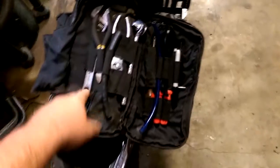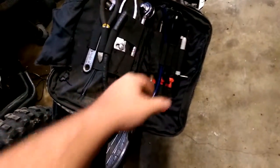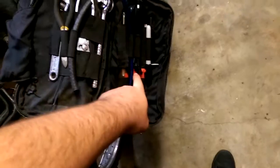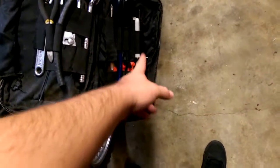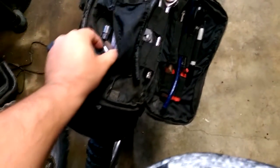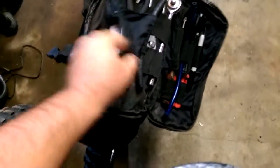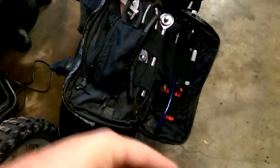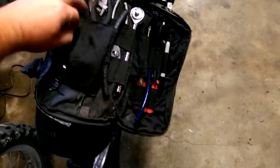It's pretty much everything I need. I keep a Crescent, some cutters, some pliers, a socket wrench, some fuel hose, another bit of fuel hose, a full-size Phillips, a small flat head for carb adjustments, a normal flat head, a Sharpie, an Allen head, lots of zip ties. Inside I keep sockets, a flat blade, a little bit of sandpaper, and a lighter — mainly because I use this on my two-stroke too. If you've ever had a two-stroke you know you can foul a plug if you've bogged it out, so I keep that for worst case. It's not much weight to keep on this bike.